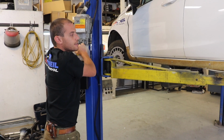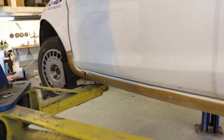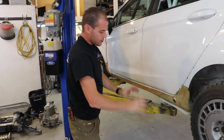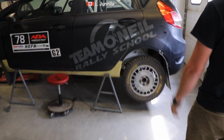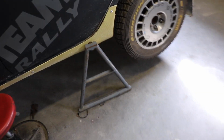We've got pin stands in these cars. These are really nice. As you're servicing the vehicle out in the wild, you don't always have a nice handy lift like we've got here. So we've got these pin stands that are a really stable jack stand. The jack stand is tall, it slides into there, you put the car down on it. I think this one's on pin stands. Yeah, this one's on pin stands, so take a quick look. This just makes it super easy. I can push on this car and tweak it around, and it's very, very safe. If you have to be getting under the car and working on it, that's a really great way to do it.